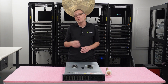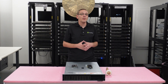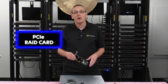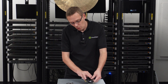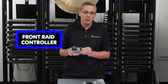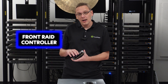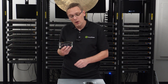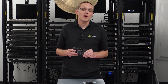First things first, there are going to be two form factors. The mini mono that we saw from the 14th gen is out — it's not the mini mono anymore. You can still use a PCIe RAID card, and that will work just fine. Or you can use the new and improved front RAID controller — it's important that you have the bracket, the card, and the caddy with it. This is the new option where you install it in the front, and we'll show you how to do the install in just a second.